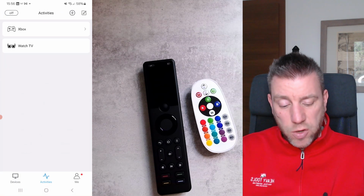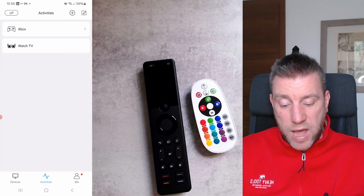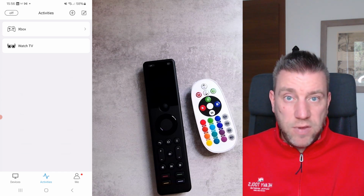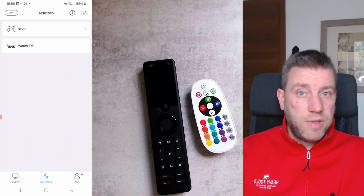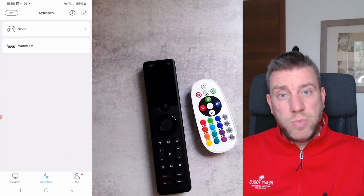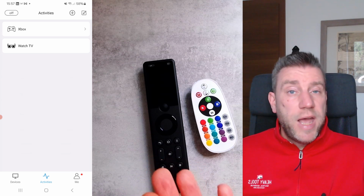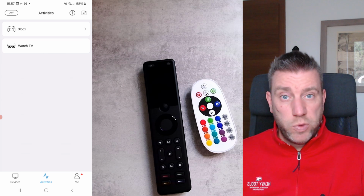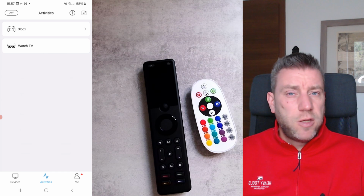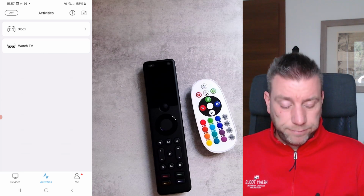And that's it. So this is how you configure your various activities. And yeah, you can have many of these activities, and maybe you have multiple activities which involve the same devices, let's say the TV and the AV. You just configure them differently. Each of them selects different sources, and it makes it easy to switch between this set of activities by one button press on the sofa button, as opposed to using two or more remotes, each switching them to different sources and some of the other things that you like to set when you are using, let's say, the TV for a different type of activity.